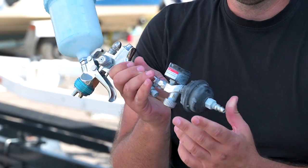The first thing is your gun adjustments. As you can see, I have this metal spray gun with a few adjustments and some adapters on it. The first adapter on the bottom is your water filter — when your compressor is running and generating heat, it creates condensation, and you don't want that water going up into your gun and out onto the paint.